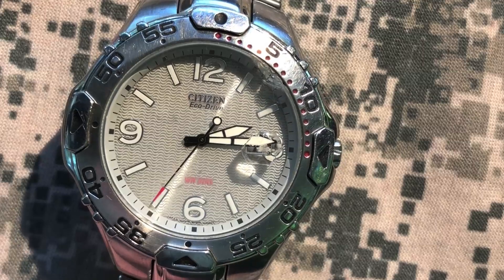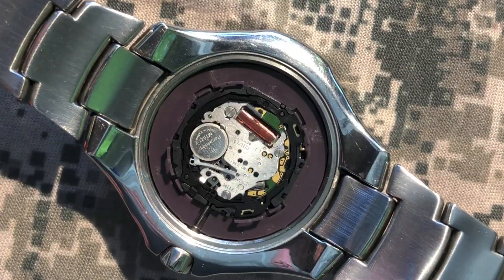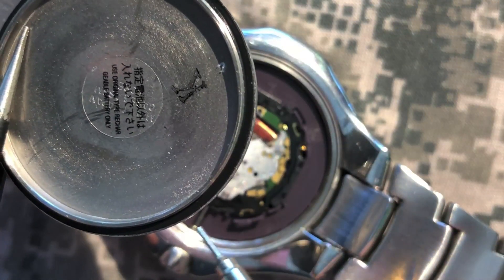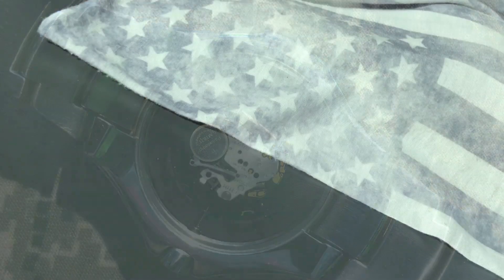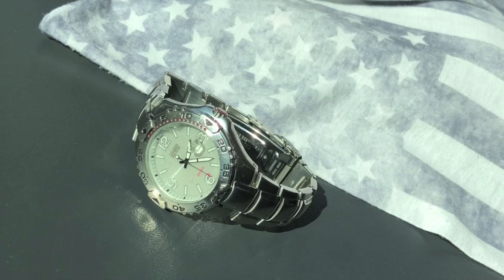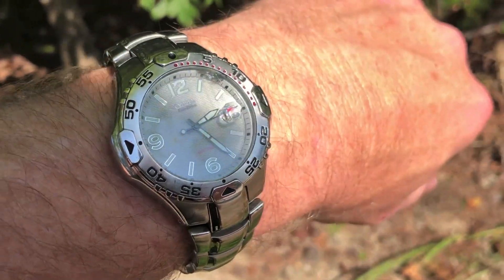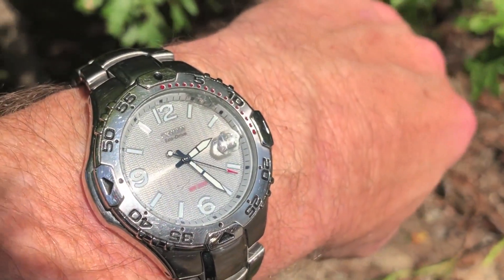When you order your watch battery, you may also want to buy a new gasket for the case back. You're hopefully not getting back in here again for another 10 to 15 years, so it's a good idea to replace that rubber seal. At the very least, inspect it to make sure it's not dry rotted, cracked, or in two pieces, because this determines the waterproofness of your watch. Set it in a sunny windowsill to start recharging — read the manual or check the Citizen website for your recharge time and best location. Full sunlight is the best way to get it quickly charged. Hit like and subscribe if you liked this video.